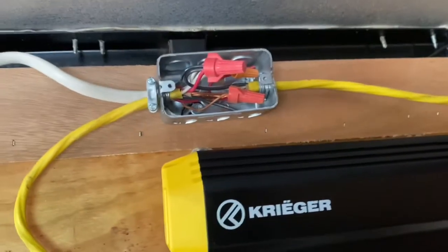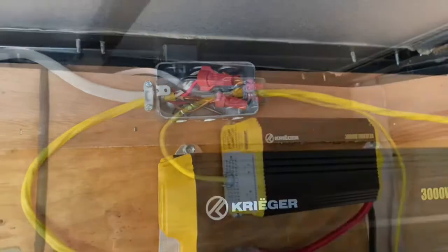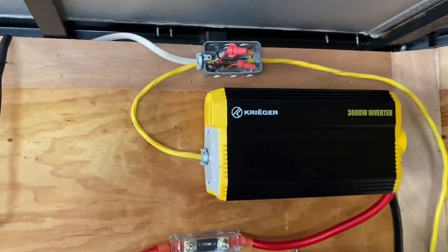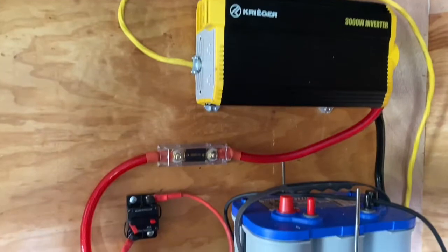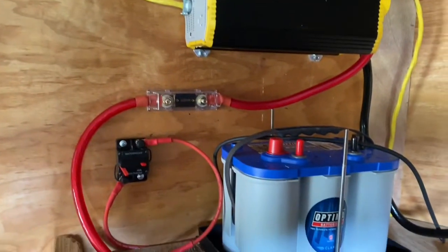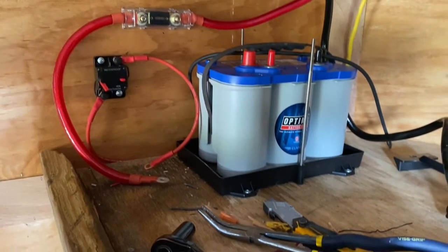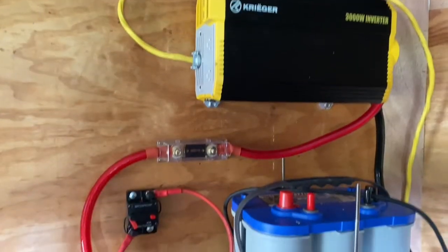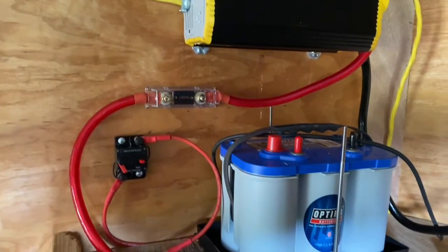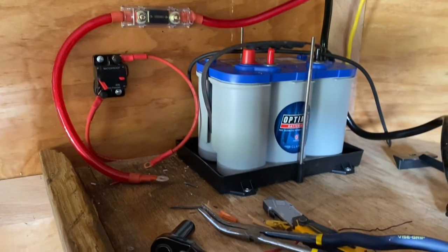As you can see, the inverter is mounted. The wires from the inverter go to the junction box — the wires for the lights and for the compressor are all in this junction box and tied together. The red wire coming off the inverter is going down to a breaker — actually a fuse — supplied by the inverter company, and I have it set up to connect to the battery nicely. You can see the 40-amp breaker with the 8-gauge wire; that's the positive side. Both the red wires — the very large one and the 8-gauge — are going to be tied to the positive side of the battery.